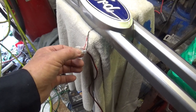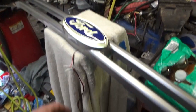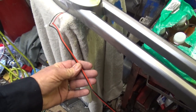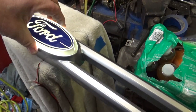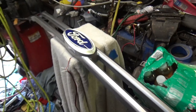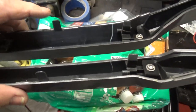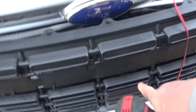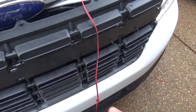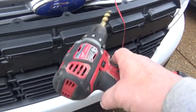I soldered the wires and then capped them off. I'm going to put some tape over it because this is going to be pretty inaccessible when I put it on, but that looks awesome. I've got some wire that's a little heavier gauge to connect up to the under-hood lights, and it's super solid on there — it's not going anywhere. These are the clips on the back of it — kind of a pain in the butt, but they should clip right back in no problem. I'm going to put one hole right here for the wiring to go in and then up around. That's really the only modification to the center portion of the grill.